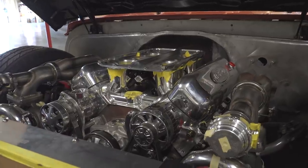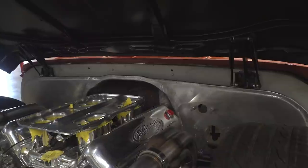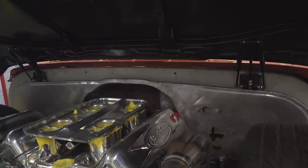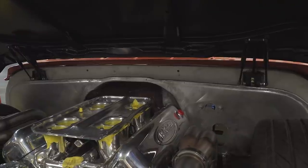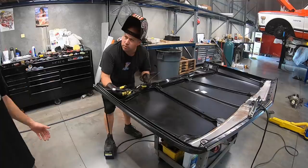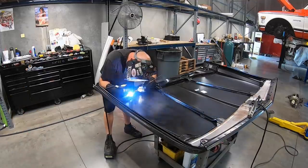You lose the hood hinges when you get rid of the inner fenders on the early '60s trucks. On the late '60s trucks — '67 to '72 — the hood hinge mechanism gets in the way of your tires as you lay down. So we move the hinges up into the cowl, flush them in there, do a little bit of welding on the hood. The hood opens by itself and stays open.